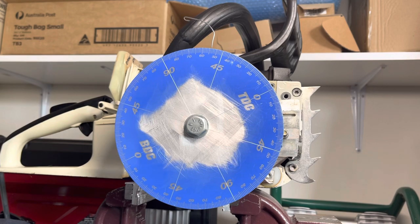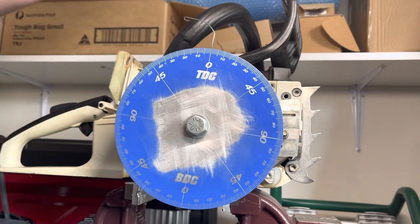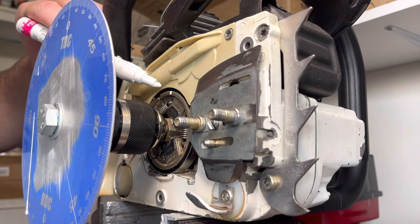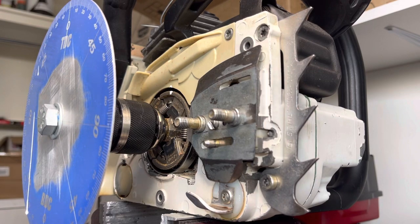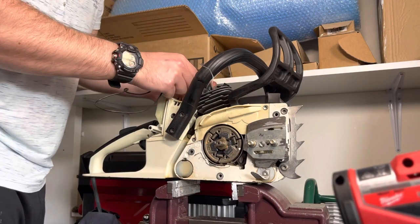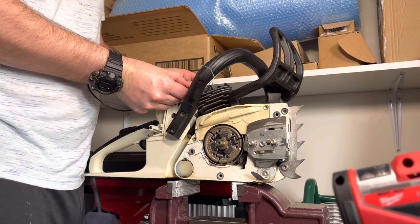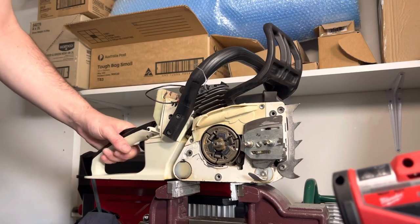This is really important to get this spot on - give yourself a bit of time, do it correctly. I'm going to get it at top dead centre, then I'm going to mark the clutch there and mark the case behind it, with corresponding lines for top dead centre. Now what we need to do is take the degree wheel off. From here I'm going to reattach the spark plug - it's important that it has the gap to jump. Ignition has to be on. I'm just using crocodile clips here - one clip there, and that can go to the cylinder.